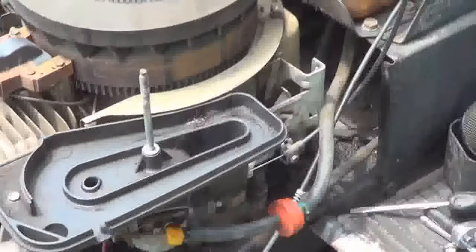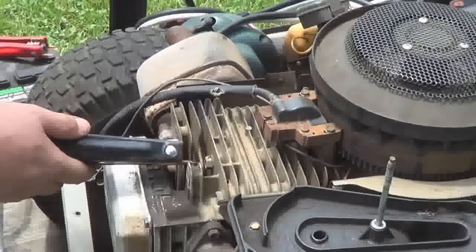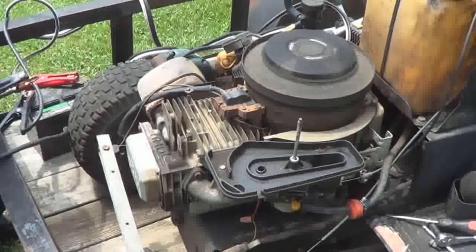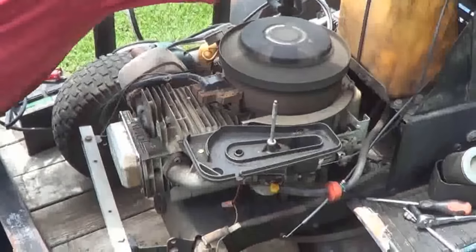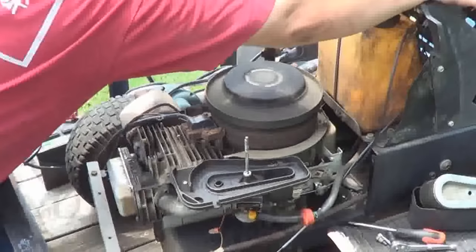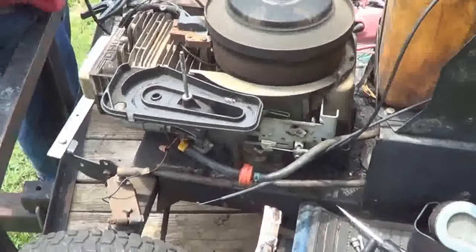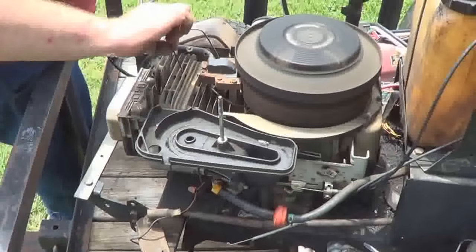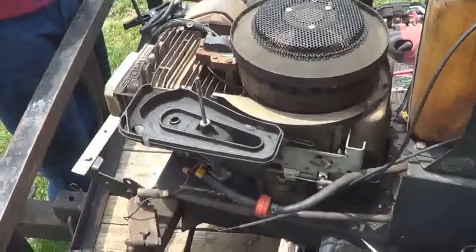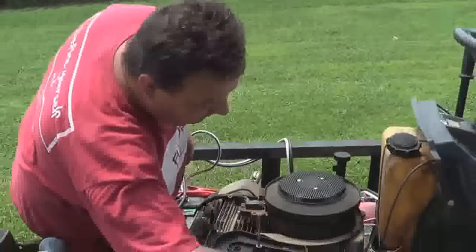Now what we're going to do is run at a fast RPM and slow it up and slow it down. We'll try to start again for what it does. Now, we're going to do a little fast, but that shows you how to set them. It could be something messed up in the governor's linkage, because it looks like to me somebody bent that in there.